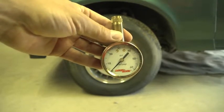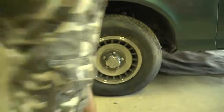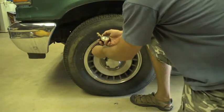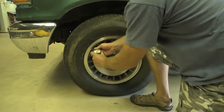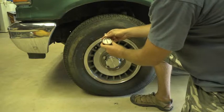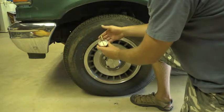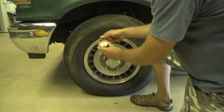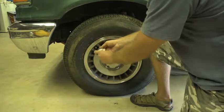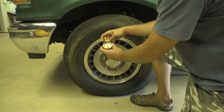So what I need is a nice precise gauge for tire pressures. I really like this one — it's my favorite. I just undo the cap, take it off, zero the gauge, put it on, and briefly but firmly attach it. I can read that it's at 30 PSI, so now I have a chance to add air, measure it again, put it to zero, and make sure there is 35 PSI in the tire.